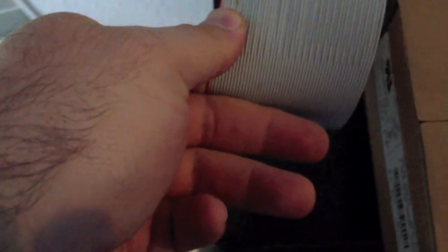Up here I have brand new 50-conductor ribbon cable — a hundred feet of it. I am ready to rebuild all these wires to go to these computers. The disk drive expansion box that I have here uses a 50-pin cable that was all destroyed and rotten. So I'm going to refurbish some of this stuff and get new cables put in.